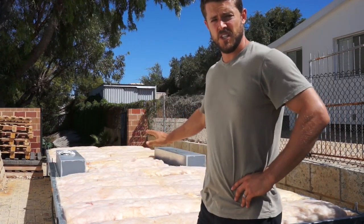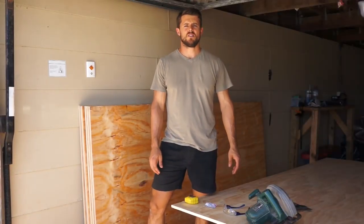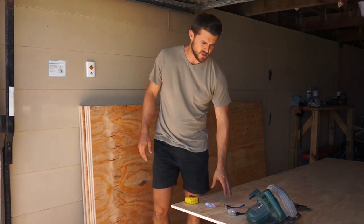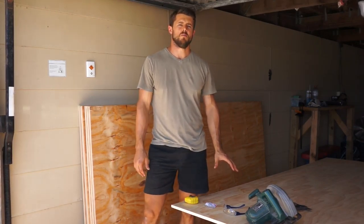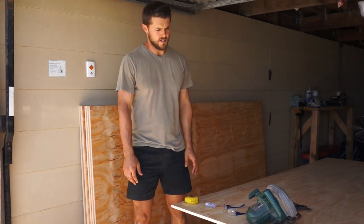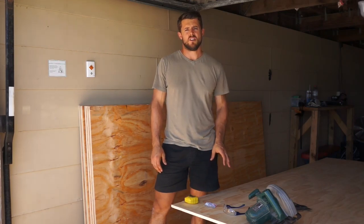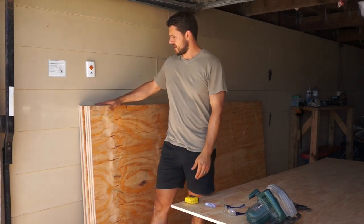So I had to go and buy another bag for that, but no big deal. We're ready to go with the capping now. We've got some plywood and we're going to be capping the whole top with plywood. Here's our plywood — 15mm thick standard structural sheets, not marine ply. You can use marine ply but you don't really need to, so we've decided to save a bit of money and go with standard structural ply. Our trailer is 7.2 metres long so we need 6 sheets, because they're 1200 wide and we're going to stack them sideways all the way down.